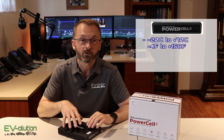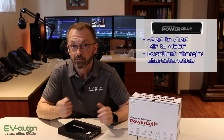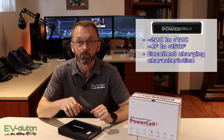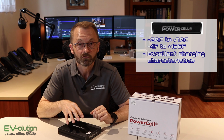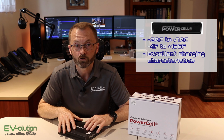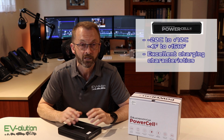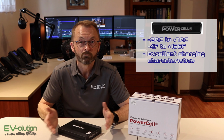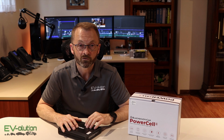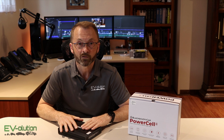Another thing that's nice about lithium iron phosphate is that they like to be charged to 100% and stay there, unlike a lithium ion pack. This will go to 0% discharge without causing any damage as well, meaning that this will last a lot longer than a lithium ion pack if it goes from 0 to 100 multiple times and in extreme temperatures. So better discharge and charge characteristics, great thermal stability, and a very safe pack to put in your car.